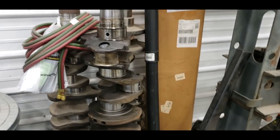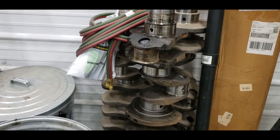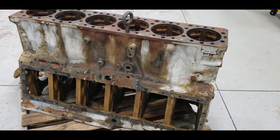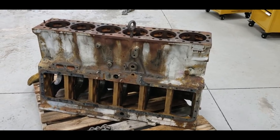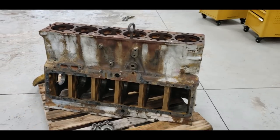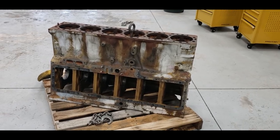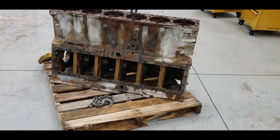This is my crank collection — this is the no-good one I just took out of that other engine. I've got two more in the back; I think one of them is already 20-under. I've also got two more 1693s out back I could tear down for crankshafts if I need to. I'm not sure I want them to hot-tank this and remove all the paint from the inside — I usually use a wire wheel in the grinder. Then I use prep-sol to get all the grease out of the cast iron pores before I paint it. This engine's going to get a high-dollar paint job, primed first, but I still haven't decided exactly what color I'm painting this truck.